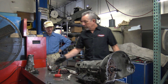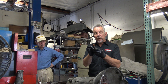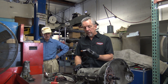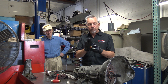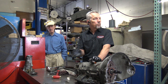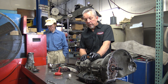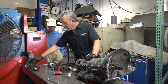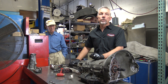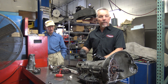The only wear area is this plastic gear — it can break, and I've seen them spin off. The other thing that can go bad is if the transmission's not serviced well enough, bushings start to go bad and there's gunk that gets in there and makes those valves stick. And if you've got a broken vacuum hose on this modulator so it can't sense vacuum, your shifts are going to be super late and super hard. You can take off and it won't shift out of first gear until the governor takes over — everything else takes over around 40 miles an hour.